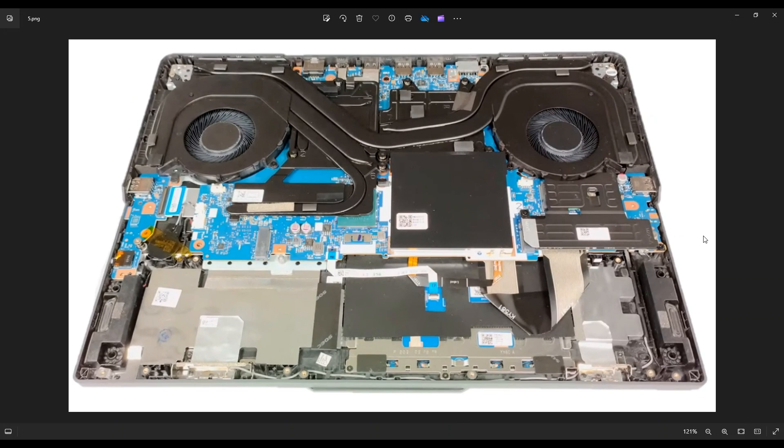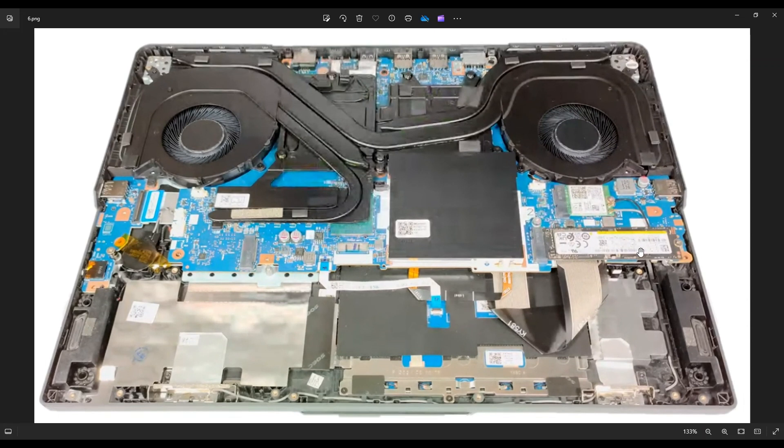Now that the battery has been either removed or unplugged, we can proceed deeper into the computer. To get at your Wi-Fi card, we're going to have to remove this second guard here. Remember, the first metal guard was over the first solid state drive M.2 port; the second solid state drive M.2 port is guarded the same way by this metal shield, and we have to take that off to access the Wi-Fi card. Same thing — screw here on the left, screw here on the right, and screw on top — will remove this shield. After that shield is removed, you can access your solid state drive and the Wi-Fi card is right here.